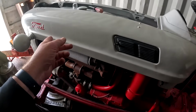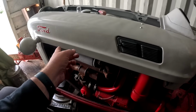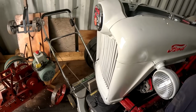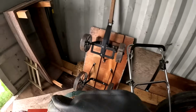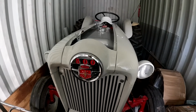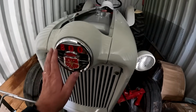But anyways, yeah, we had a problem in that front cylinder. Something was weird with that sleeve. We got it in, but I don't know how it didn't break, because it shouldn't. That thing was really hard to get in, if you remember that video. Us bashing on that thing, holy crap. I'm amazed it didn't break that sleeve, but I guess I didn't size the rings. I should have probably sized those rings in there. The way it was, though, the piston was already in the sleeve, and I figured everything was sized, because it should have been, right?